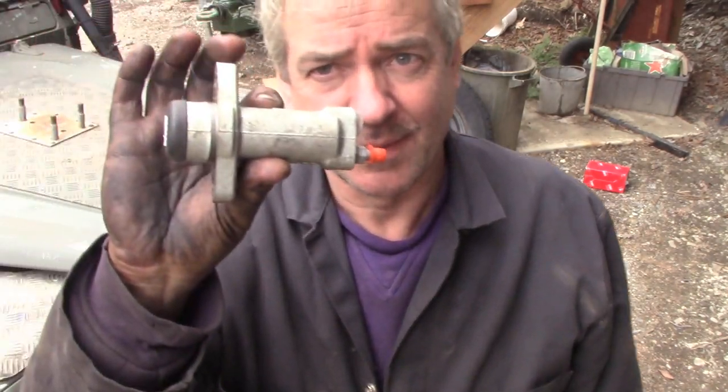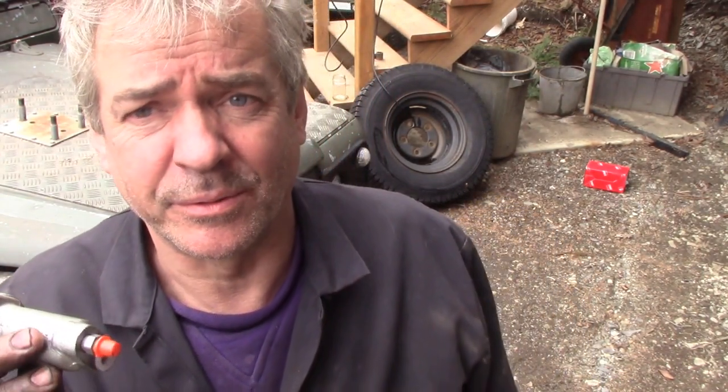It's horrible. I took it for a drive up the road and it's really bad to drive. The clutch is so far down on the floor. So, what am I going to do? I have a brand new 300 TDI slave, like the original one but not leaking, on the shelf. I'm going to put this on. I'm not going to film it, but I'm going to push it up, put it on, bleed it through, because it really is easy to replace and stuff like that. It's not the end of the world.